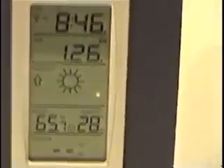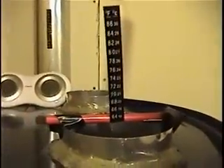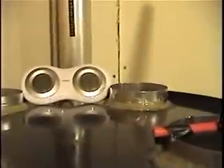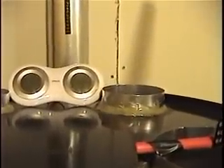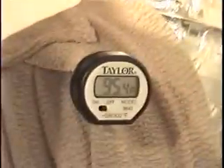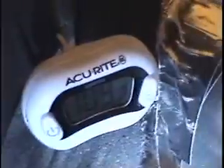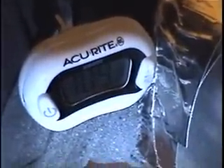Now a reading after 30 minutes. Room temperature is 65.7 degrees. Air temperature coming out of the tubes is 70 degrees. Temperature on top of the drum is 76.5 degrees. The air outlet temperature is 95.4 degrees, and the inlet air temperature is 109 degrees.